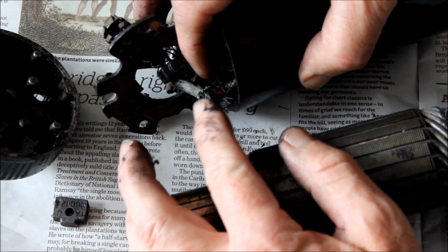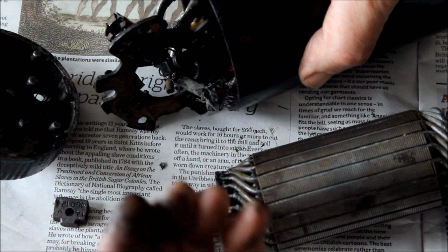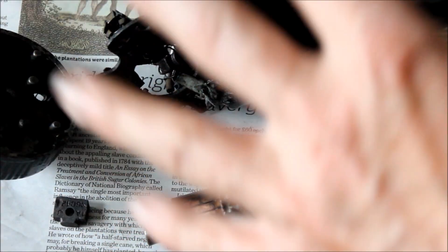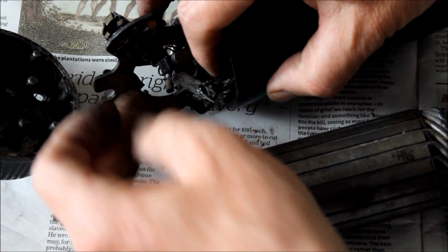Now if that inner cable there was touching the outer case, then who knows, that could cause a short, which in turn could cause a massive voltage drop from the M unit into this thing, which of course causes the M unit to shut down. So maybe that's the suspect there, that could be the problem.